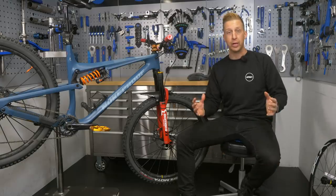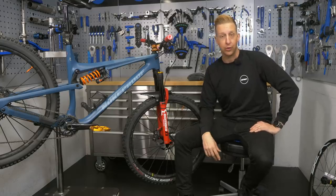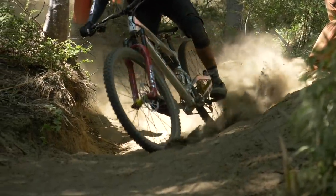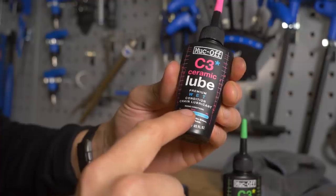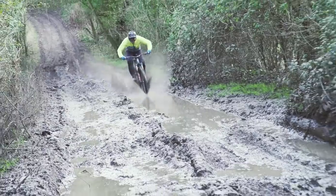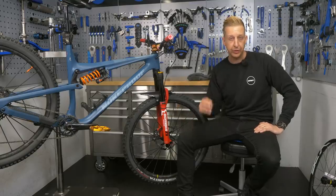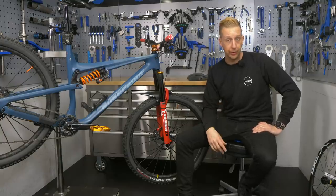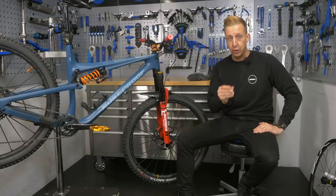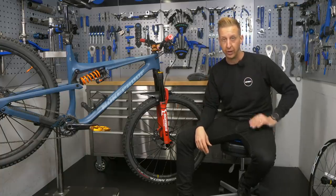This one always makes me chuckle — dry lube isn't actually dry. There are two main types of lube: wet lube and dry lube. Both of them are liquid-based. Wet lube is designed for wet conditions; it's a much thicker, more viscous liquid that's very water-repellent. When you put it on your chain it stays in place, the lubricating particles get into the chain and stay there. The downside is muck and grit can stick to it — but if you're riding in wet conditions, you need that constant lubrication. A dry lubricant, however — the wet bit in a dry lube is not the lubricant; that's just a solvent carrier for application, to get the lubricating particles into the rollers and pins of the chain. Then it evaporates, leaving it as a dry lubricant so other stuff doesn't stick to the chain.